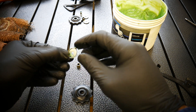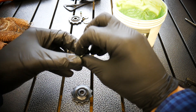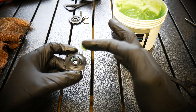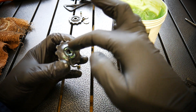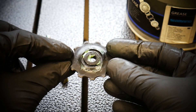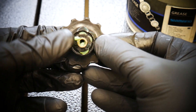On the bolt - don't put the grease on the thread because there is some thread lock on it. We just want to have some grease on the bolt where there is no thread, because that would be a problem for you. So more grease - this was my problem here, too little grease.